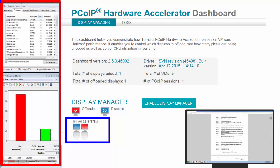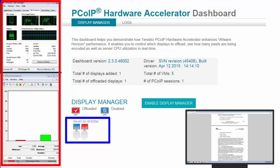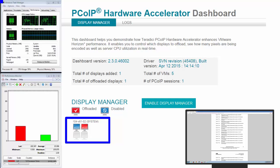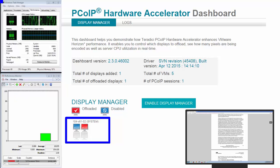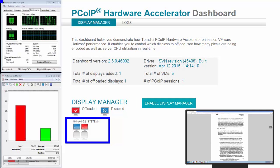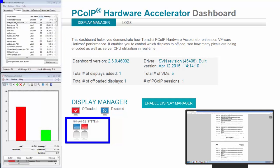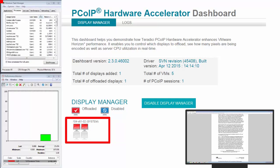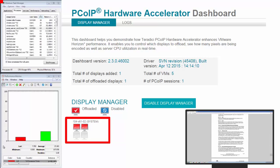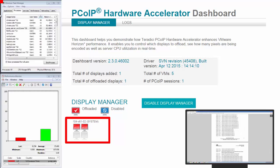Have a look at the PC over IP server in the corner — we are hitting numbers of 50%, that's a full core. As another effective demonstration, under performance you see how heavy and taxing PDF scrolling can be on CPU cycles. With the card, virtual CPU headroom is added to any VDI implementation to enable higher densities without impacting the user experience when multiple users are moving around windows, playing videos, scrolling documents and other things. We will offload this screen and as you can see with the card enabled, you are now averaging 4%. Fairly significant results, and this has nothing to do with video.